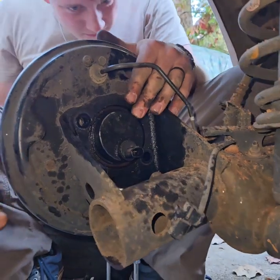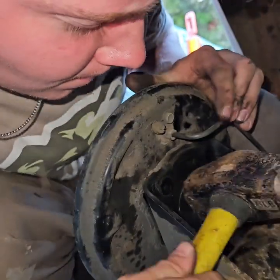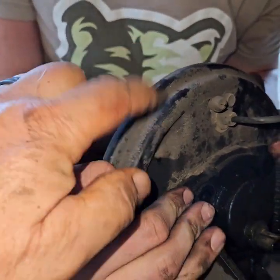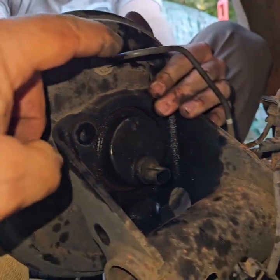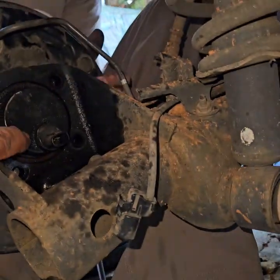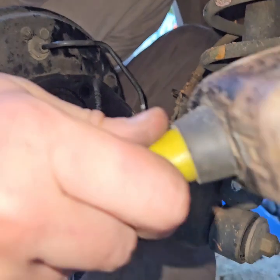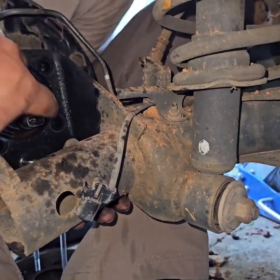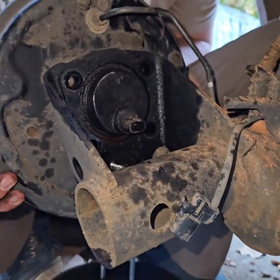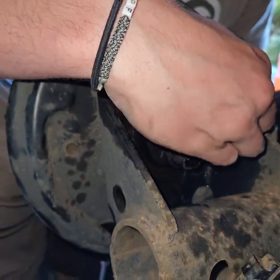Is it almost out? No sir. You want this to stay — yes — because you don't want to break the brake line. It looks like you need to tap on the bottom of it for sure. Take a socket and put it around there — take a big enough socket and go grab a 27. This is the hardest thing, especially when they're rusted, is to get that back plate off of there.